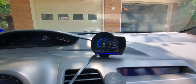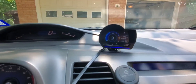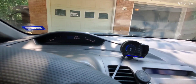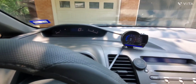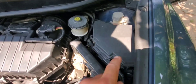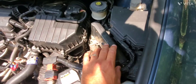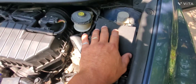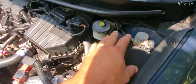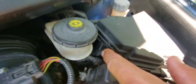As you may have seen in one of my previous videos done about a week ago, I replaced the ELD that is under the hood of this 8th gen Honda Civic. The ELD on the 8th gen is underneath the fuse panel. You have to remove the airbox cover, remove the computer and the battery so you can get the panel on its side just enough to unplug the connectors, and then take out the entire panel.